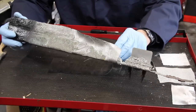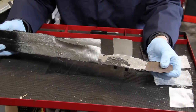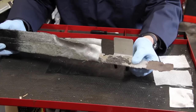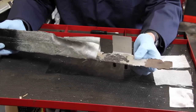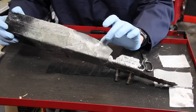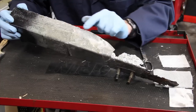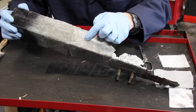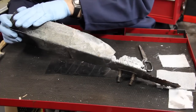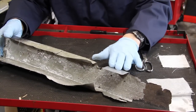This piece is an example of what I call some pretty extreme rust repair. You can note here that the rust is scaly and significant, but once I start coating it with miracle paint there's a real strong bond between that and the metal itself. The other interesting thing about miracle paint is it responds very well when used with fiberglass cloth — almost as well or even better than some types of epoxies. Look here how I've used multiple layers to build up not only strength but to repair the cosmetic aspect of the rust.